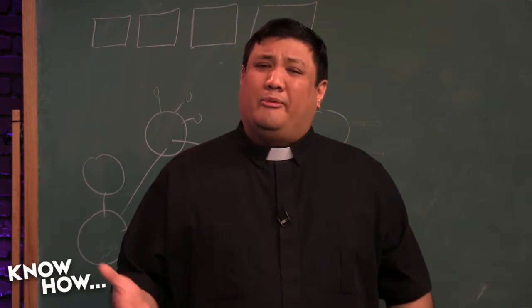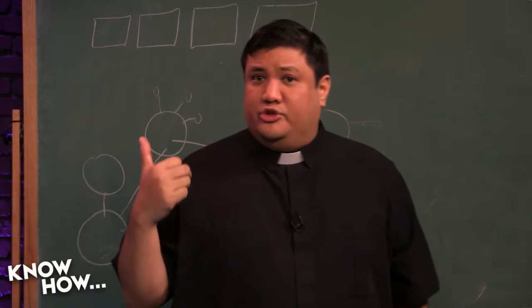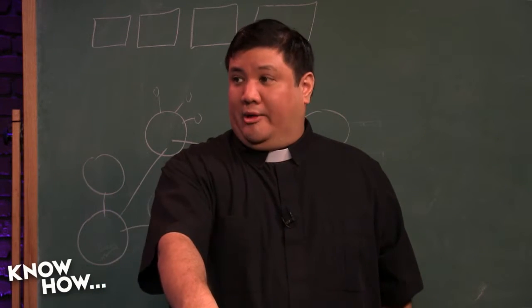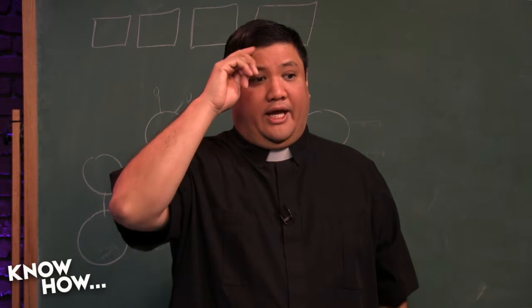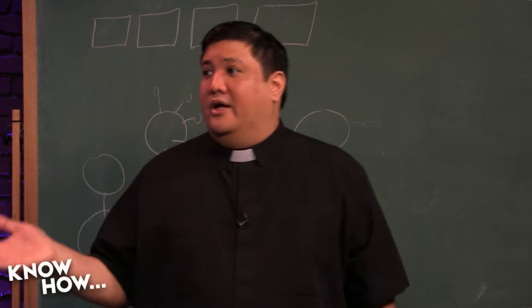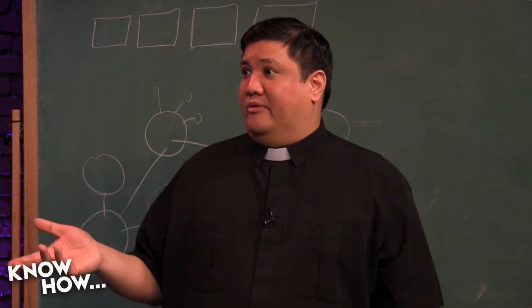On the wireless side, it's about half the speed of the Synology. It does dual-band — both 2.4 GHz and 5 GHz simultaneously. It does 2x2 MIMO instead of 4x4 MIMO, which means on 2.4 GHz you'll get about 400 megabits per second max — half the Synology — and on 5 GHz you'll get 867 megabits per second, which is again about half. Slower, but the price makes up for it.